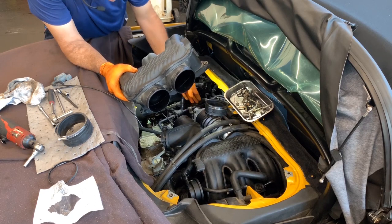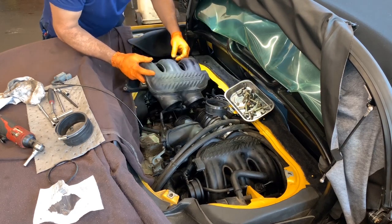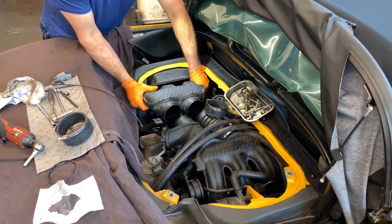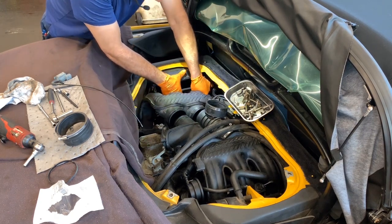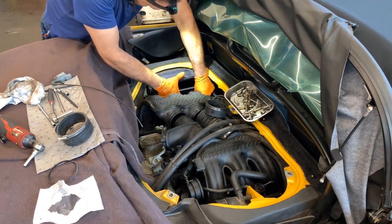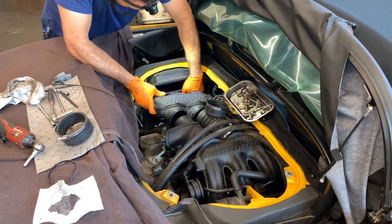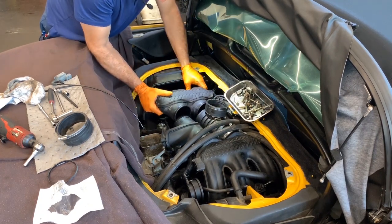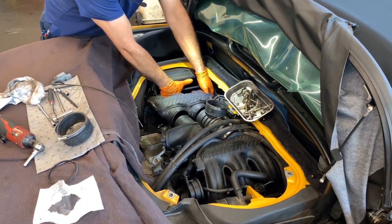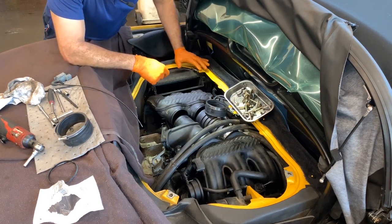And we have a clamp under the intake that you need to tighten before you do the whole thing. So you'll see it in yours. Yes, watch me have fun. I mean, don't force anything. It's not hard of strength, it's just hard of room. I hope it makes sense what I'm saying to you. But if you play smart and do things without pushing too hard, it will go smooth. The main concern is this hose. It has to go in through the intake, under the injectors, and connect onto that place on the back.